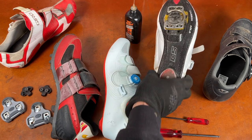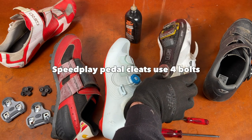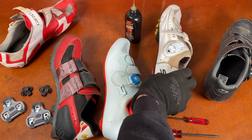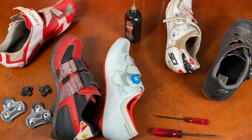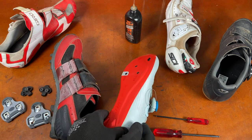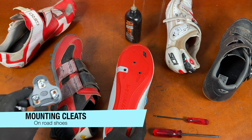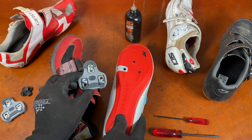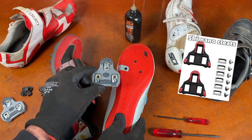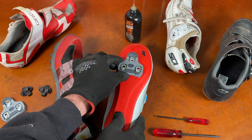Here's a shoe with four bolts. So you might have two bolts, three bolts, or four bolts. The cleats come with your pedals and you want to install them on the shoes first before getting to positioning them correctly. On a three-hole shoe, the cleats will look something like this with three bolts — usually three spacers with the bolts. Then it's pretty much just putting the cleat onto the shoe by screwing the bolts into the holes in the shoe.